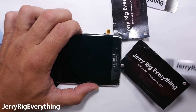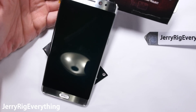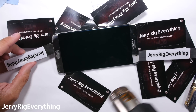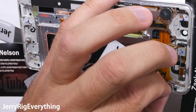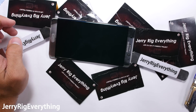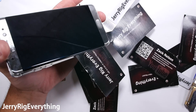I wonder if Samsung could develop some kind of adhesive pull tabs — like under iPhone batteries — that help it release more easily. One little pull tab inside the phone and all the adhesive under the screen would come off; it might add slight thickness but would make replacing things a lot easier. As you can see, the screen replacement is getting pretty involved — heating every 30 seconds and sliding playing cards along the side, making sure to avoid where the AMOLED screen starts at each corner. Here's where I made my first big mistake: I slid my card in underneath a ribbon cable and sliced right through it, which is probably pretty important. There's also the ribbon cable at the top, the main AMOLED ribbon, and at the bottom the two menu buttons and the home button itself.